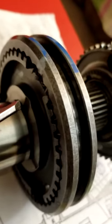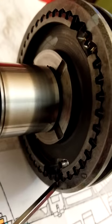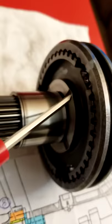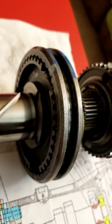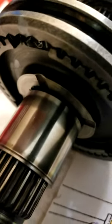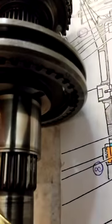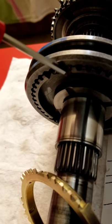As I mentioned before, before taking this apart, you must mark on the ring the location of the three springs. If everything is okay, the springs are still in place. In case you separate these two items by accident, it's not a big deal — just pay attention when you relocate it to replace your springs in the same spot, and reset those two together keeping the spring in the middle of the gap.